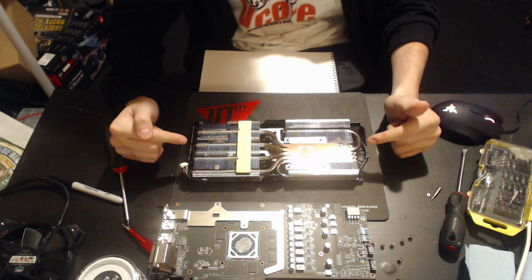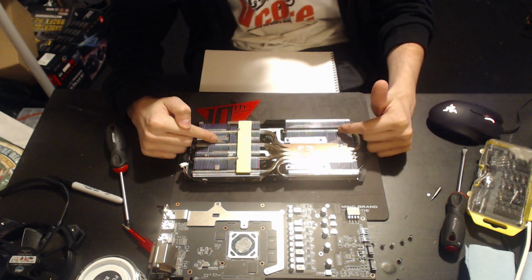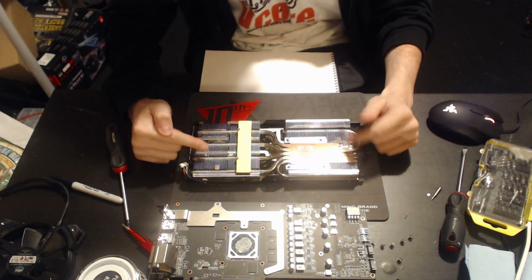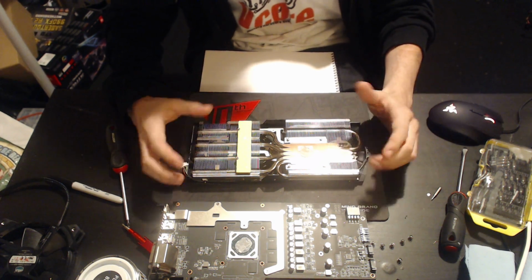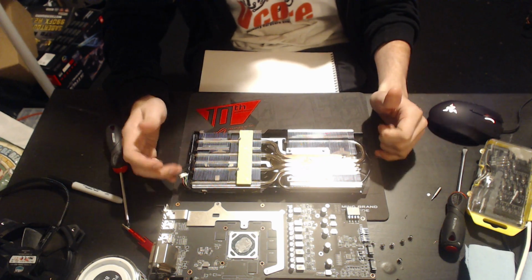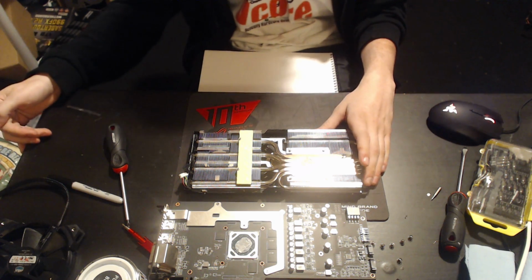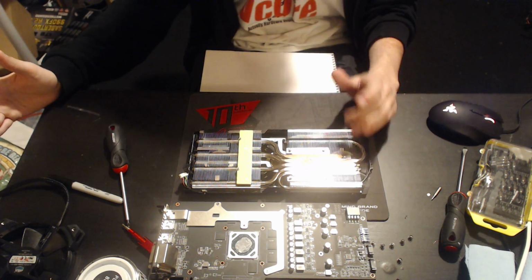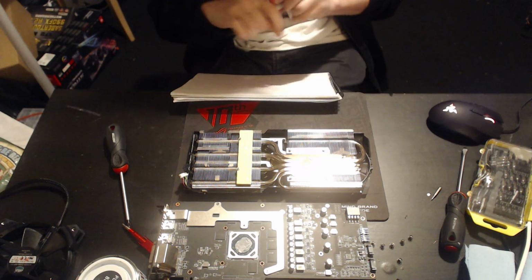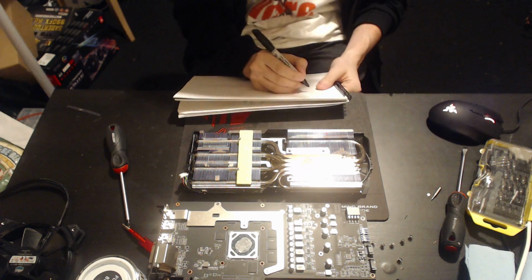By which I mean, if you hit 100% fan speed, the performance compared to, say, 35% fan speed is not a whole lot better. Well, it's a lot better than 35%, but you get the idea. Basically, I expect a big drop in temperatures if I put the fan speed all the way to the maximum. The STRIX doesn't really have that. And to illustrate, I'm just going to draw two generic curves for fan speed versus temperature.